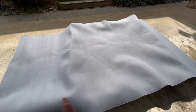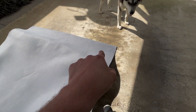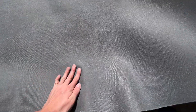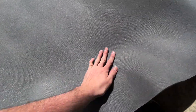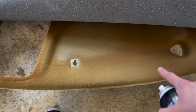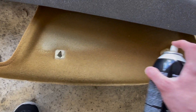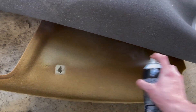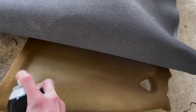So I've laid the headliner out. I have about one yard too much of it, excess on this side. I want to try to get it as straight and parallel with the headliner board as you can to keep bubbles from forming, and just smooth it out as you go. Try to smooth it out the best you can before we start applying any sort of adhesive. You're not going to get it perfect. Make sure you get all of the excess glue and pieces off of there. You'll spray some of the spray adhesive all over the place, then lay it back down.